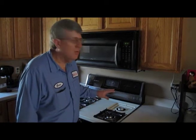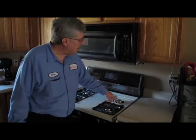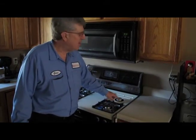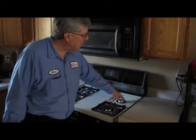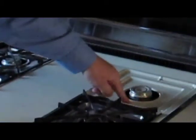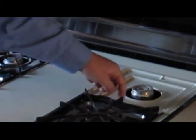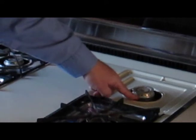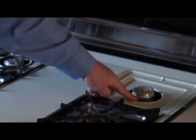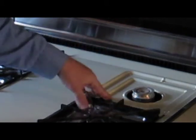Here's how it works. Back in the day, when you turn the stove on — a lot of people think this is instantaneous but it's not. Gas would come out these holes here; there's also three little holes in front here, and the gas would shoot out, hit the pilot light. The heat from the pilot light would ignite the gas, it would flash back, light these three little holes which gas comes out of, and then light all these here. That was how it worked with pilot lights.